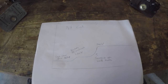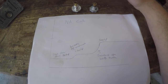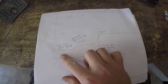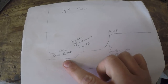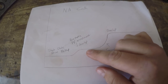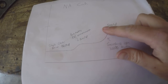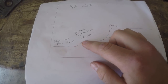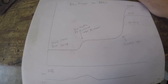Now that we know what the power valves are, let's talk about how and when we use them. Here's a simple drawing of a naturally aspirated carburetor setup. At around 150 horsepower you're in steady state driving on your primaries and idle circuit. When you give it some throttle your power valve enrichment gives just a little bump to keep your air-fuel ratio nice and steady — maybe 12.5 or 13s. Then at full throttle you open your secondaries 100% and spike up to maximum fueling at, say, 500 horsepower.